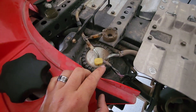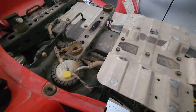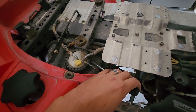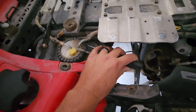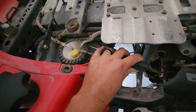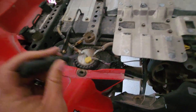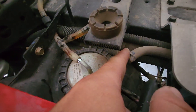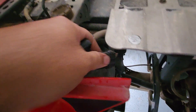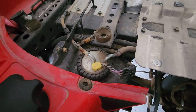The way you remove this pump is you get a flathead screwdriver and with a few knocks of a hammer you unscrew the cap. Then you remove these hoses — there's a clamp right here that'll pop off — and your wire harness right here just disconnects.